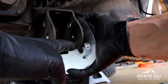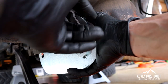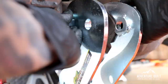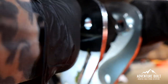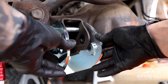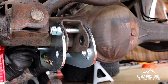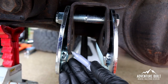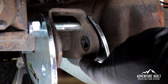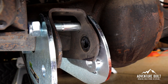You can see what has to happen — we have to trim the metal, just the little tip off the edge here, to recess for this to line up and get that five degrees. I've got the front top holes in. Now I'm going to put the back holes in to hold it in the exact spot we need, and then mark the cut. When you make your cut line, be very conservative — you can always take it down more with the grinder.